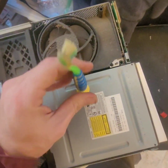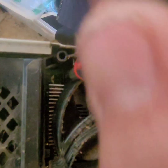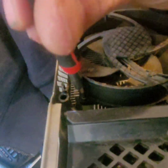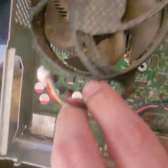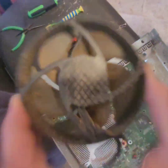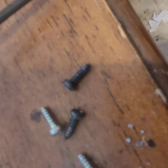Time to use the handy dandy toothbrush. Fan shroud looking a lot better — let's get the fan off. We're gonna use a bigger tool for this. Had to remove these two screws to unplug the fan. Now we can clean this disgusting thing up. When I was cleaning the fan, these two black screws kept falling out — if the fan was spinning really loud, maybe it was getting stuck on these screws, and maybe that's why it was overheating, plus the dust.